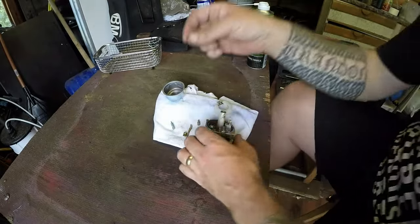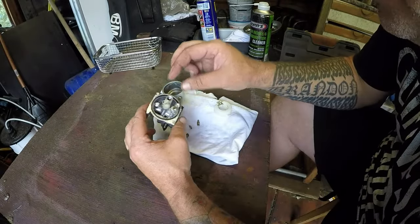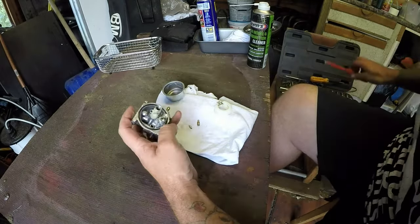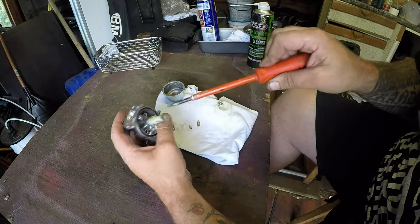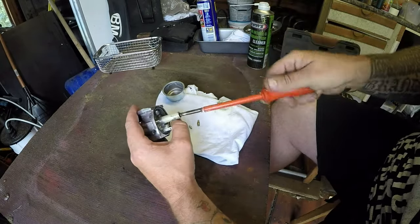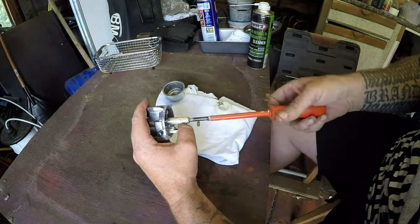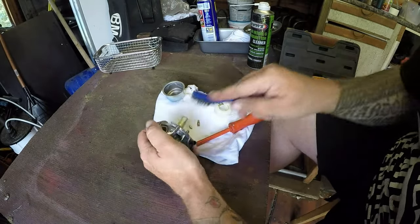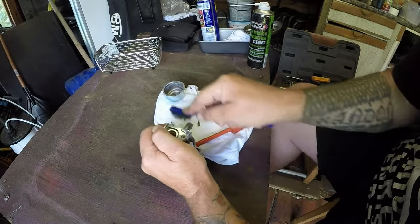Okay, that's that all now done. It's just blown out. Tube goes in, main jet in, and I use a slightly bigger screwdriver than I did for that one. Still a bit residual on here, but that'd be nothing to worry about. I could get the wire brush on it maybe, just to see if it comes off. Yeah, it will do. I can give it a clean.